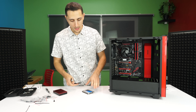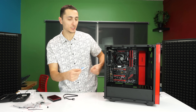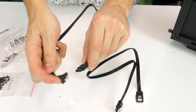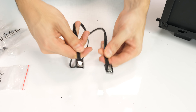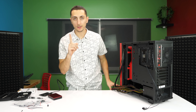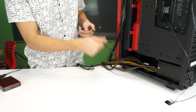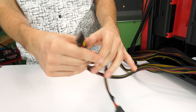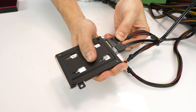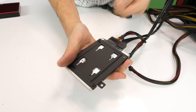Before you put the SSD back inside the case, I strongly recommend hooking up the cables first, because once it's secured back there it's really difficult to reach in. You'll need a SATA cable — there are two types, one with two flat ends and one with an L-shape. Don't use the L-shape for this case; use the flat-end one. Flip it with the clip facing down and snap it in place. The other cable comes from the power supply and provides power to the SSD. Grab one end, slide it in, and make sure it's fully seated with no gap. Both cables go in only one way — if it doesn't connect, flip it over.